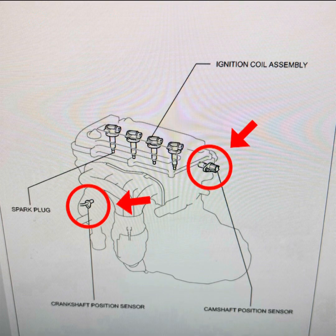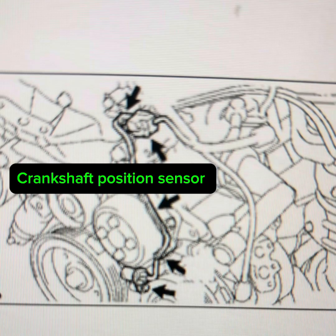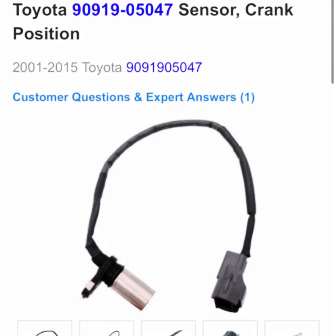Let's move on to the sensors that send inputs to the ignition system. One of those sensors is the crankshaft position sensor, located on the front of the timing cover. When removing it, be very careful not to break the connectors. Here's a picture of what it looks like. It also has an O-ring that can leak — just something to be aware of. The job of this sensor is to let the ECM know the position of the crankshaft. This is important because the ignition coil has to fire at a certain time. If this sensor fails, the ignition system won't know when to fire, which can cause misfires and other problems.